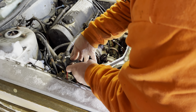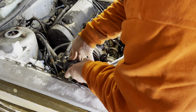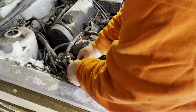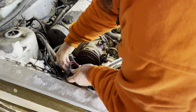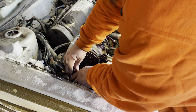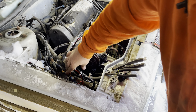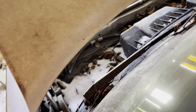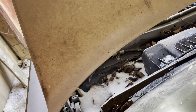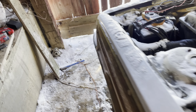This is the alternator I bought to replace the original one, and it's actually bad. I took it for a test drive, came back, it wasn't working. I talked to a few people and they said to check the field wires — these are the field contacts. If it is an open connection where there is no connectivity between these two, that means the alternator is bad internally.